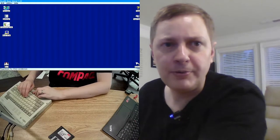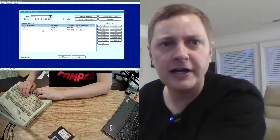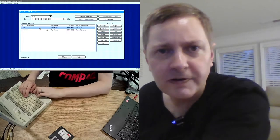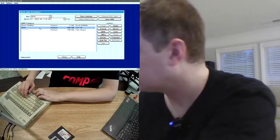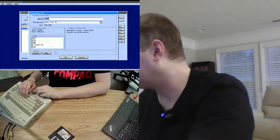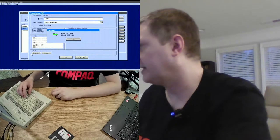So I'm going to come in here to boot it, and I'm going to create a partition for Windows 95. So we're going to have DOS. Actually, let's figure out how much space the DOS is taking. Let's just pop it up over here so I can see it. If we go here, you can look at the free space if we go to details. So the DOS is only taking like 250 megabytes.